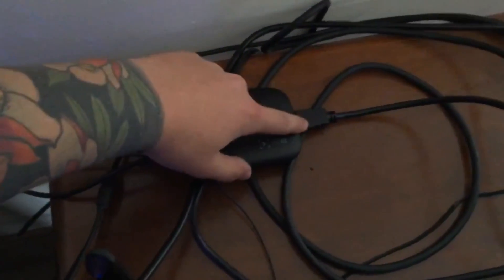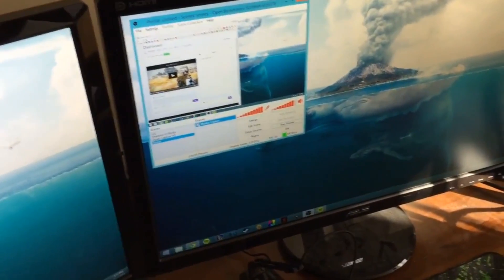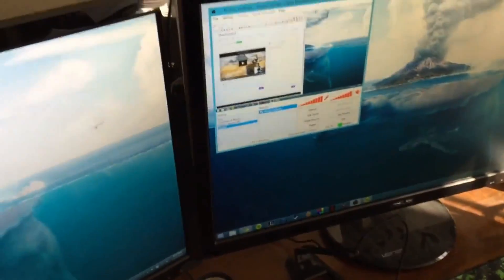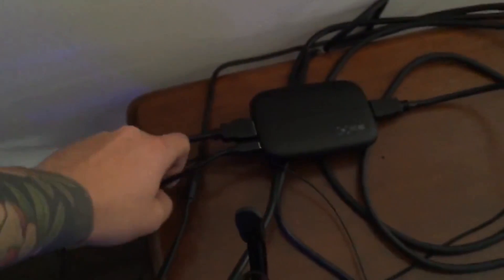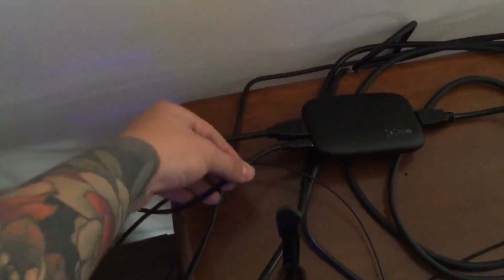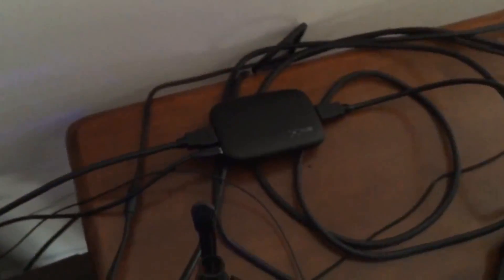This is the cord right here that comes from the PS4 and goes into the HDMI in. Then we have this HDMI over here that goes into a monitor — mine is this monitor, so I can just hit the button down here and that will switch the input to HDMI. This is where I'll be watching the PS4. The other part of the HD60 is this mini USB to regular USB cable, and this I plug right into the PC into one of the USB slots so that the HD60 has power.